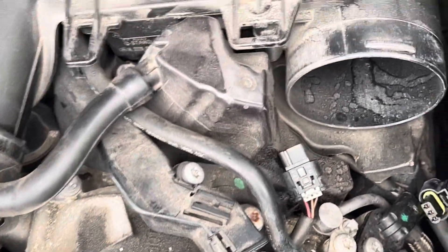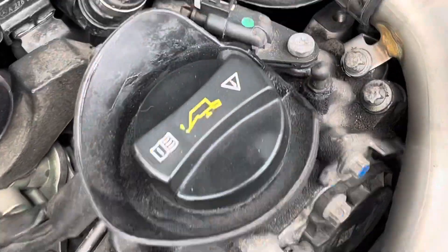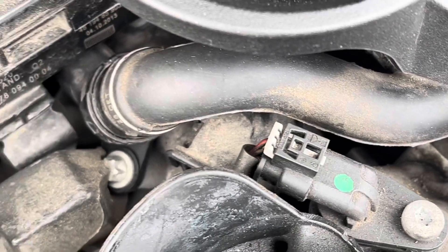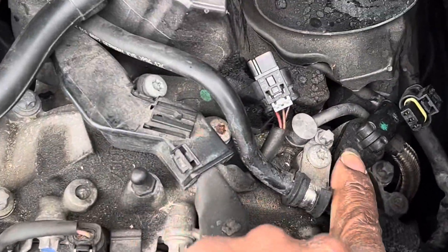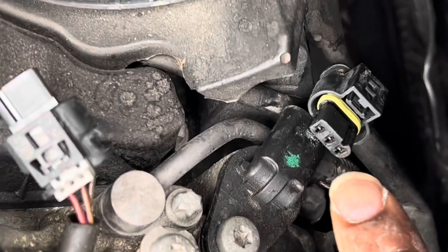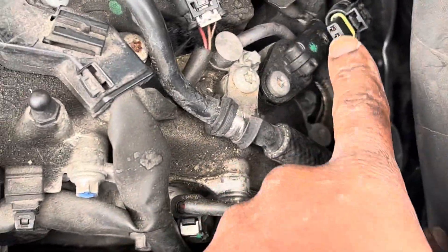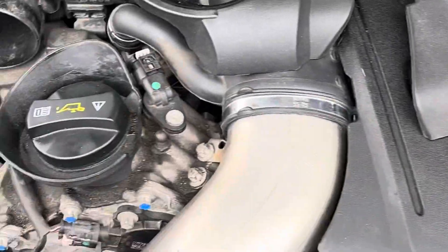The code is not related to those magnetic sensors — it's these camshaft position sensors. Now, you can replace them or you can open them up and disconnect them, and you'll typically find that you have oil on the actual connector. I unplugged these because I found oil all over the connection right up in here. That oil causes it to short out — it's conductive and causes those sensors to not read properly.